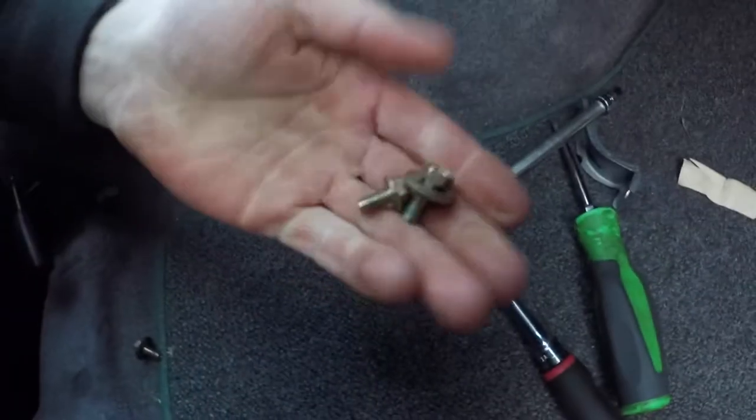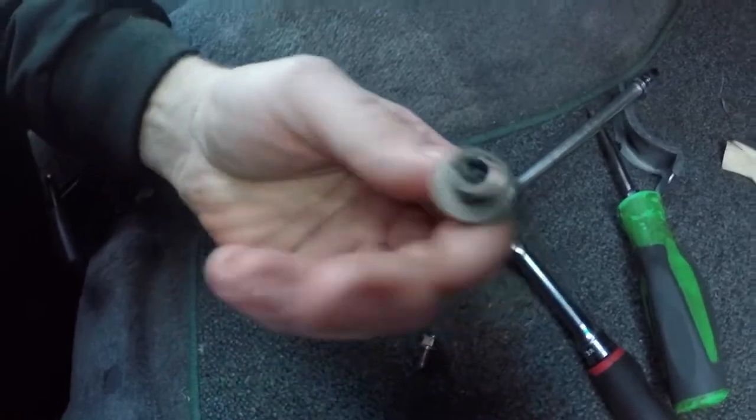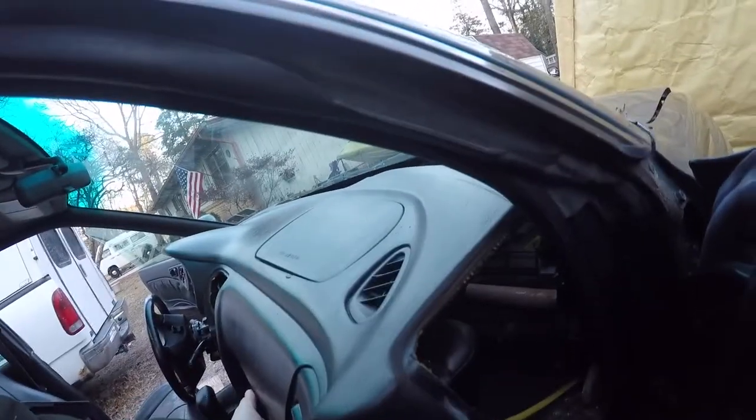Okay, so after fighting for about 10 minutes here, I noticed it was kind of tight on top. So what I did, I checked underneath the glove box here, and you can't really see, but you're gonna get 2 to 3 more, I think that's actually 2. Just take the 2 bolts out. They're up top in here, and I think they hold the airbag in. So this should all come out as one unit now. Let's see. Aha, there we go. The glove section.